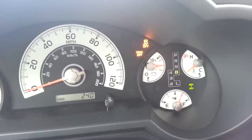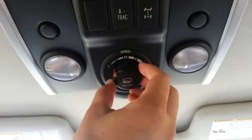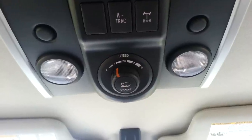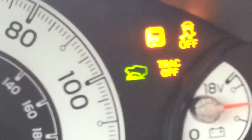The crawl control feature can only be engaged when you're in four-wheel drive low. If you look upwards towards the ceiling, you have your lights controls here on the side — and this is the crawl control button. You push it, and I'm going to set it to between low and medium because it's more precise than we really expected. You can see back here in the display area a little green light showing you that the crawl control is activated.